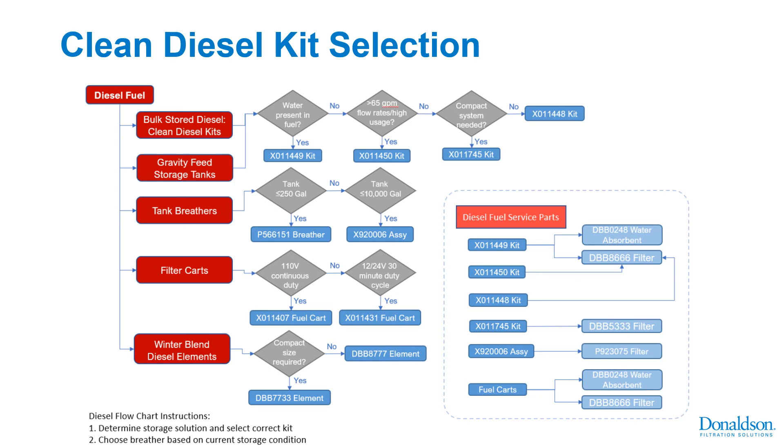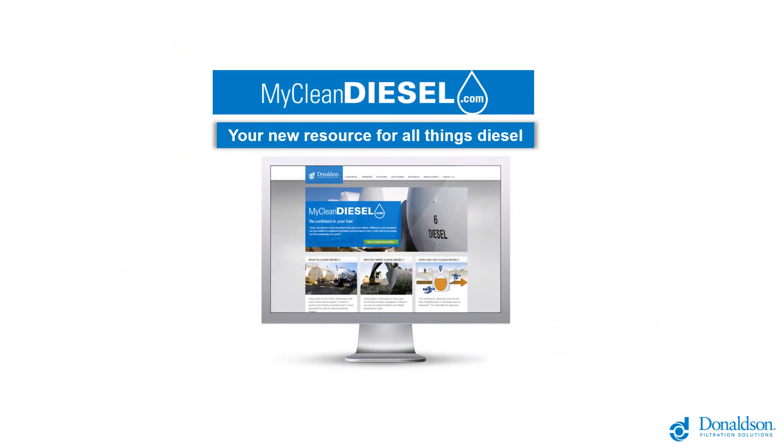Lastly, we have a line of filters for winter operation. Winter fuel can be trickier to filter at high efficiency, but we have a filter that does a very good job and handles fuel that's at or just above its cloud point a little better. Once fuel hits its cloud point it generates a huge amount of particles and plugs most filters — there are operability issues in winter that everyone knows about, and this filter is designed to handle that better. If you'd like to learn more, visit donaldson.com and look for the My Clean Diesel section and other webinars. Thank you very much.